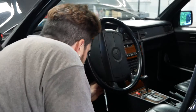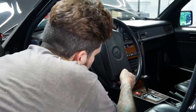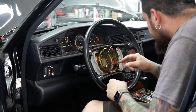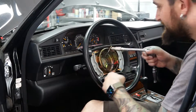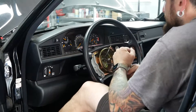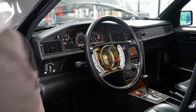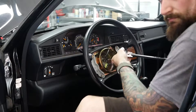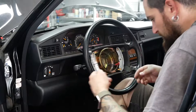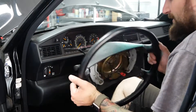This is what we're working with — I'm gonna try to take these out one at a time. That's off. There's a 10 millimeter allen key in here so I'm gonna try to get the steering wheel off. Got a longer one for more leverage — there we go. That almost went to no man's land. You want to keep the steering wheel as straight as possible when you do this. That was pretty damn easy.